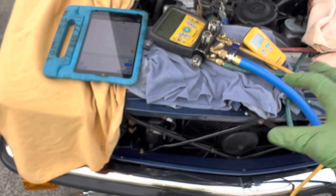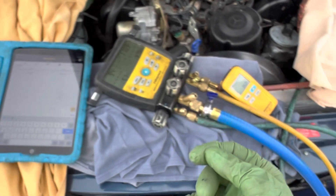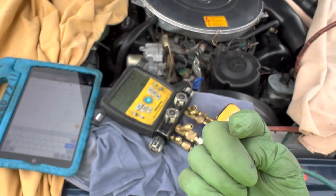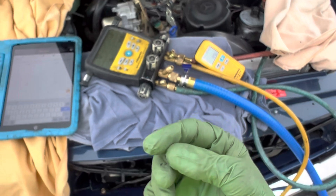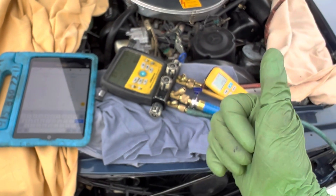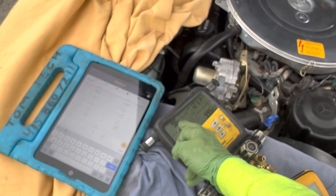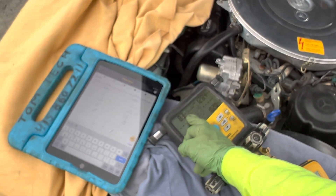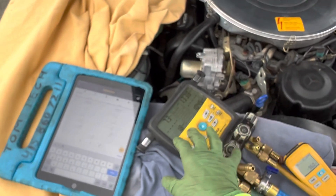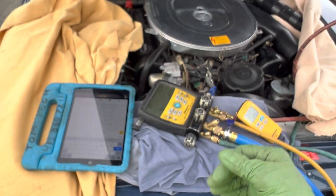I had this on a really long vacuum to get it clean and dry. I did a triple purge with nitrogen, left it on, and did the nitrogen pressure decay test — I made a video on that before this. Now it's just running nice and cold. This is going between 8 and 10, about 10.5 on the low side — and it's at high idle right now too. Beautiful car. See you guys later.